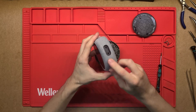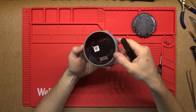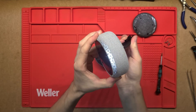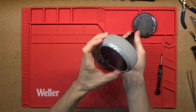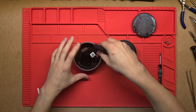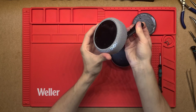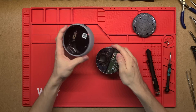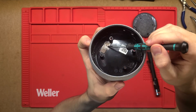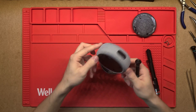Undoing those four screws on the bottom, this whole plate just slides right off. Interestingly, there don't seem to be perforations throughout this bit - the perforations are only in this top little area, which actually sits on the bottom. So that's the only place the sound is going to come out. And then there's something here that all Alexa devices seem to have - if anyone knows what that is please leave a comment. I reckon it's just an RFID tag to identify units during manufacturing.